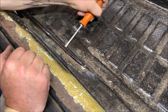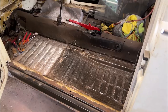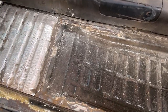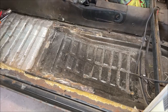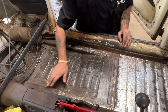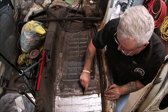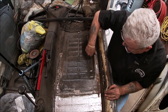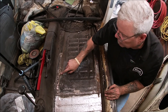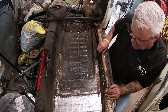The bracket is now removed. I did drill a hole in the floor but it's okay — I'll go ahead and plug weld that shut. I actually lectured you about not doing that and did it anyway. This is all smoothed out on top. There was some rust up front — I was wire wheeling like crazy but couldn't find all the spot weld points. This is all cleaned up now, not as clean as it's going to get. I'll apply the seam sealer I have on hand after I drill the holes.